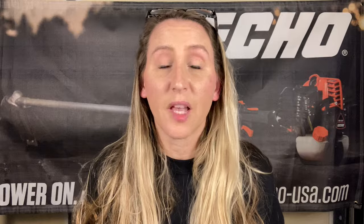It looks good to me. So if you're ever in doubt about whether your saw is oiling enough, all you've got to do is point it towards the ground, rev it up a little bit, and if you see that stream of oil you know you're good to go.